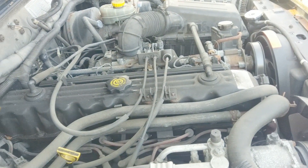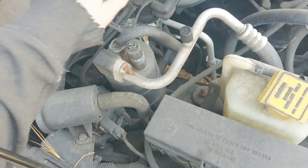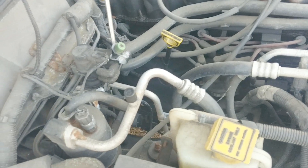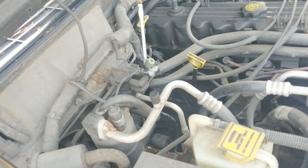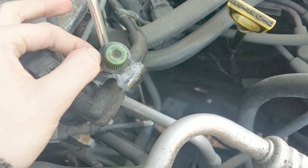So what did I do? I went to YouTube and watched a video - now I'm a genius, right? I know we got some evap things over here, and basically what we're looking for is a vacuum leak somewhere in the evap system. We've got an evap test port over here - one psi max.